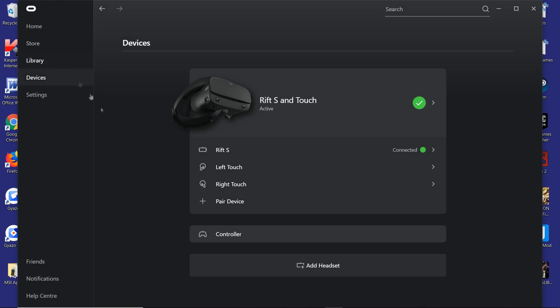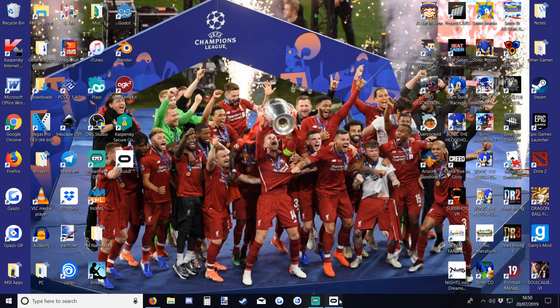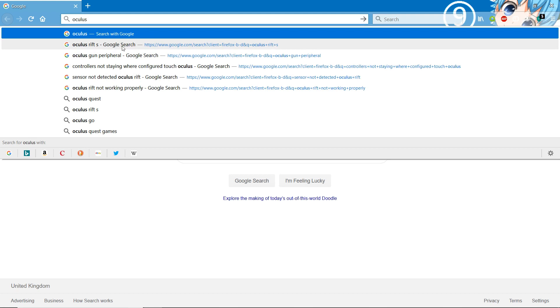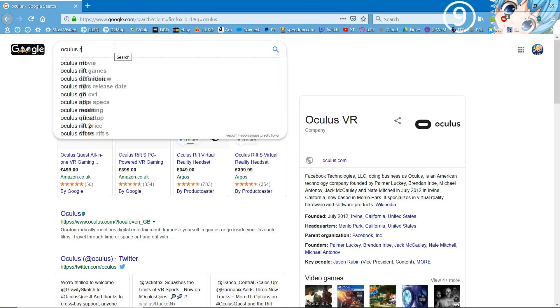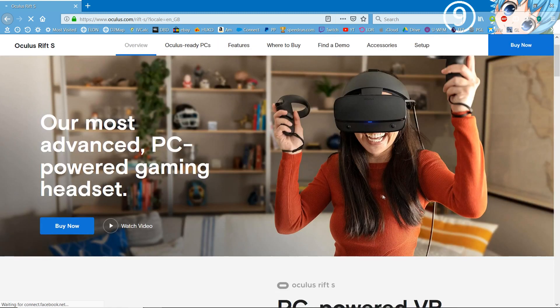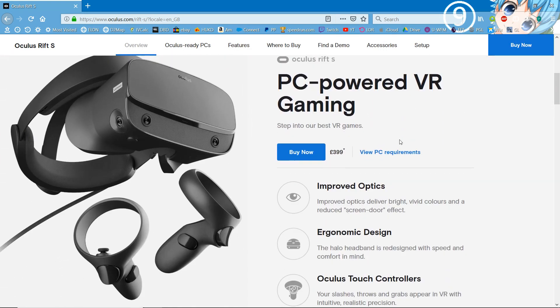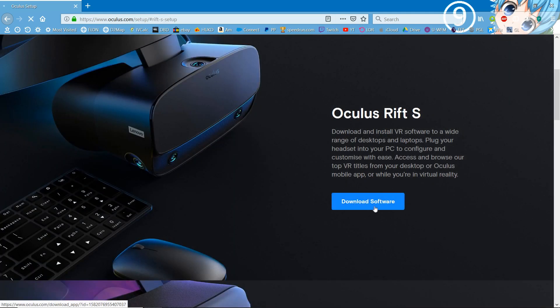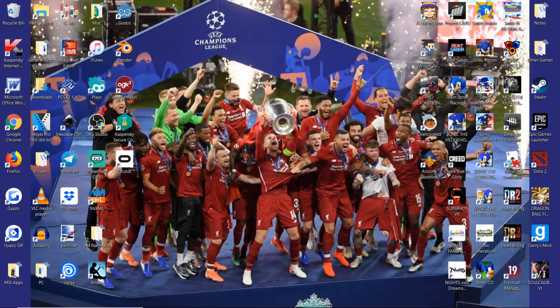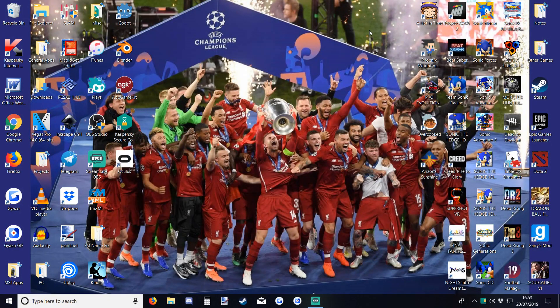If it doesn't work, another thing to try is to see if the Oculus software could be corrupted. If that doesn't work, go to Oculus' own site and try to re-download the software from scratch. If you've already got it installed, it'll give you an option to repair. Download the oculussetup.exe file, run it, and click repair. If none of that works, send a ticket to Oculus Support and try to get a return, because one of those fixes should hopefully have resolved the issue.